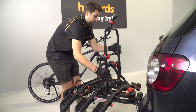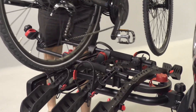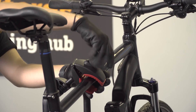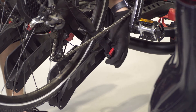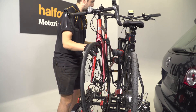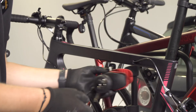To fit bikes, pull the central support column down. Start with the one closest to the boot. Slide the bike's wheels into the wheel tray closest to the boot and behind the central support column. Raise the central support column and clip the frame into place. Secure the wheels with the fitted straps. Install the second bike facing the opposite direction.